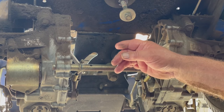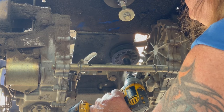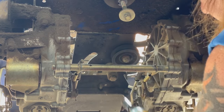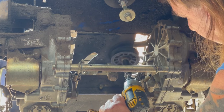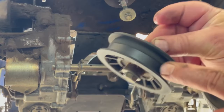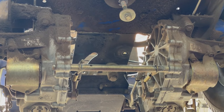That one's getting bad too, so we're just gonna go ahead and replace that one too. See how the belt was kind of grooved in there — plus the bearings are going bad in that one too. So let me go find some idler pulleys and the belt, and we'll put this back together again.